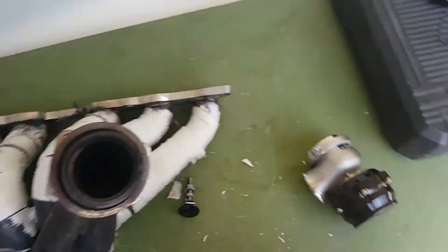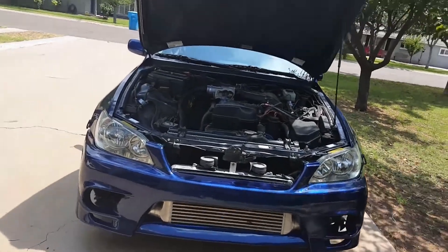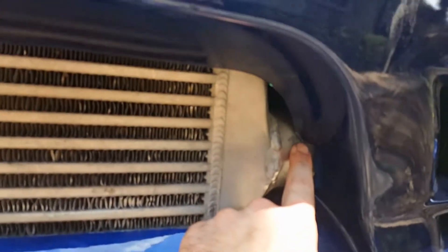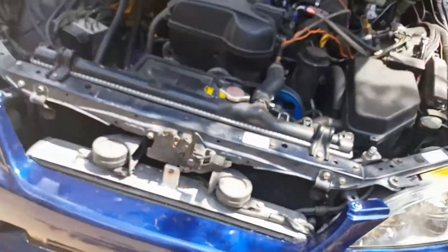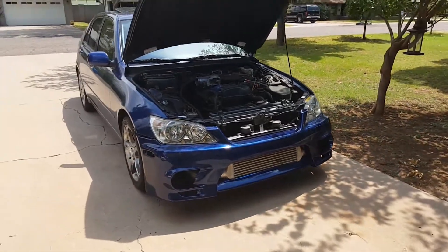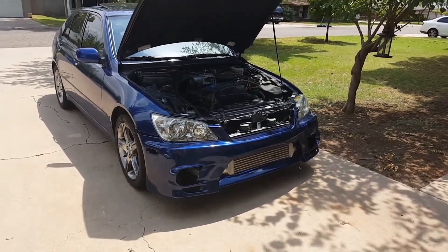Test fit of the new bumper — I'm not sure I like it. It fits like shit. I need to cut out around the intercooler piping here a little bit more so it sits flush. Even the headlight doesn't fit right. It's a fiberglass rep, what can you expect — but I got it with the car. Maybe we'll mock it up and make it fit right, maybe not, we'll see.